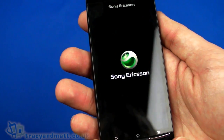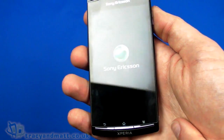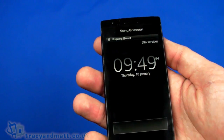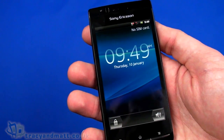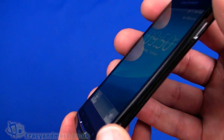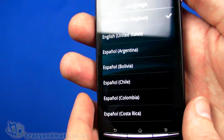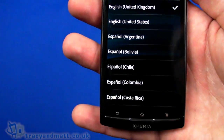One thing I must comment on, having already seen this handset demoed a couple of weeks ago, is the quality of the display. Display doesn't come across very well in a demo video, I appreciate, so you have to take my word for it. It is a normal LCD display, obviously capacitive touchscreen — no AMOLED, no Super AMOLED or anything like that — but they've done something with the screen that makes it really jump out at you. Also, the front plastic portion over the display has no air gap between it and the LCD panel, which adds to the quality so you don't get as much reflection — you're only seeing it from one surface, effectively not two.